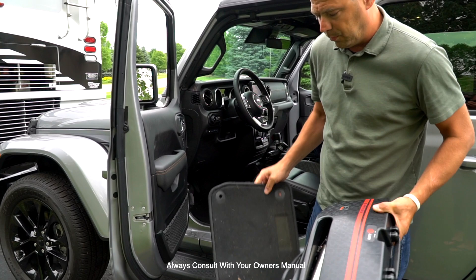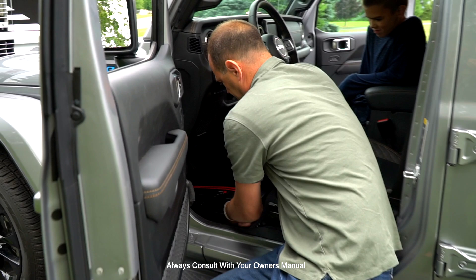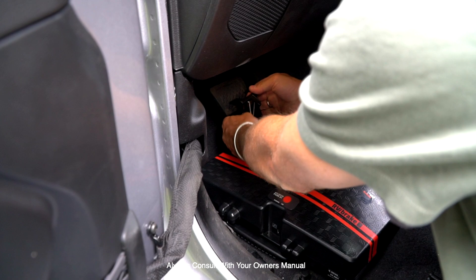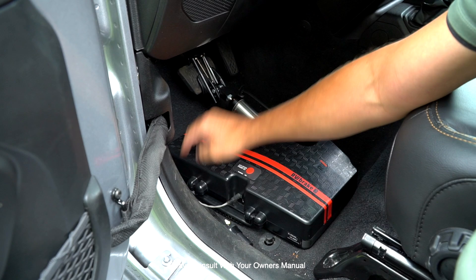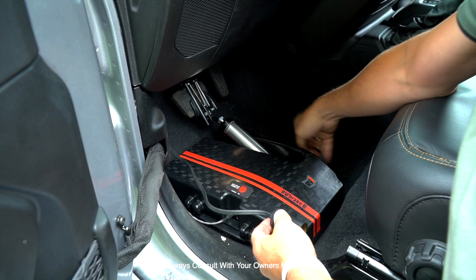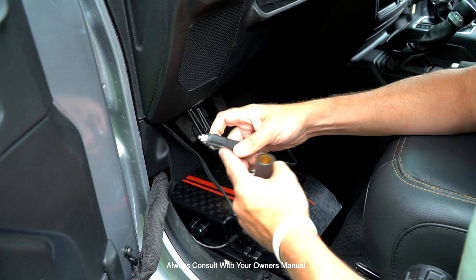Make sure the unit is all the way in the back position and set it on the floor. There's a clip that goes around the brake pedal — that's it. There's one plug here that goes up front for the breakaway switch: in the event the vehicle breaks away from the RV, this is what activates that. We also added a dedicated 12-volt power that goes right out the firewall directly to the battery, because this Jeep does not have an active power source when the vehicle is off and I didn't want to leave the key on. There is a 12-volt active power source in the cargo area if you'd rather run it back there.